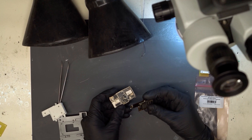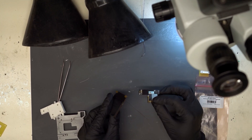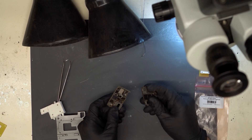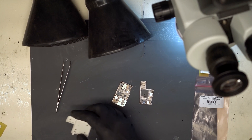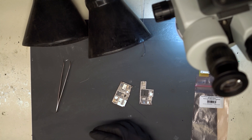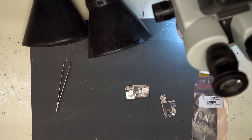And we know that we can just re-ball the middle layer. But in this case, the board actually looked perfect — it wasn't bent or anything. And in the testing jig it still is not working, so we know that something else is the cause. We're going to try to diagnose and repair this issue, which is likely going to be on the bottom board.